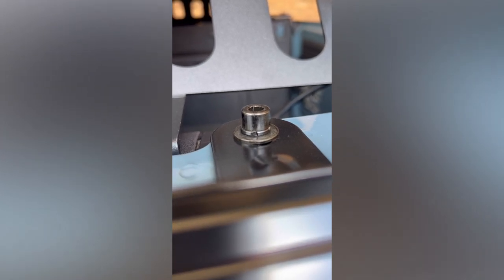The next piece to install is the rear tub rail bracket. If you notice, there's foam on the bottom — that's the side that goes to the body panel. The wider tab goes towards the front of the vehicle and will line over the factory holes. We use one of the two shorter M8 bolts and the longer M8 bolts in those two spots. You can see on the opposite side how we've just barely crushed those lock washers — there's a good spot where you can see the split. Just slightly crushing, no need to over-torque, but get nice and snug. Those are the two sections of the rear soft top hardware included. You can see really nice lines on the body, curve matching perfectly.